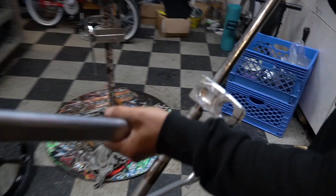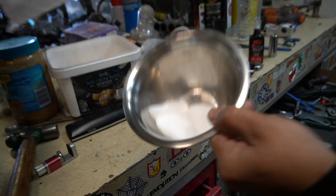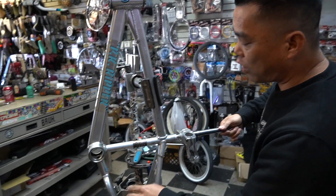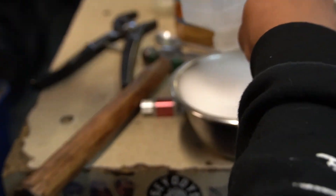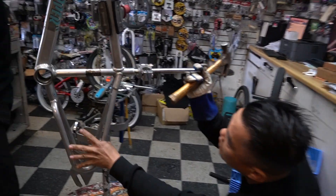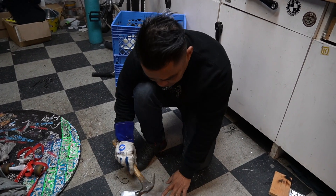Here's the setup. We're going to feed this seat post more dry ice, wait for it to drop to maximum temperature, then heat this area up and try to hit it out. We're breaking the dry ice into little bits to put inside the post. I have gloves on this time — the other day I didn't, and it actually burned my finger because this is really cold.